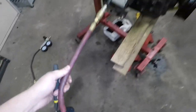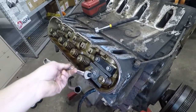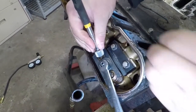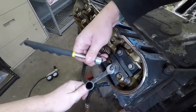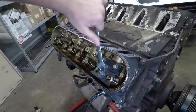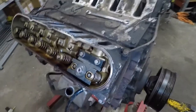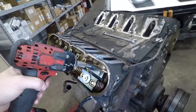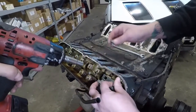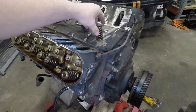We deleted that regulator and just put the shop air hose straight into the cylinder, and the keepers broke free. Yeah, come on — there we go. Drop them right in the pan. Now we loosen it. I can't back the nut off without it going flying, so I'm just going to loosen this. Grab the bolt — we're going to be taking the pan off anyway, so even if they fall in it's fine. There you go, your springs are free.